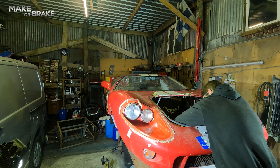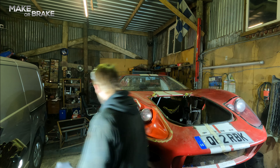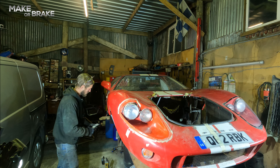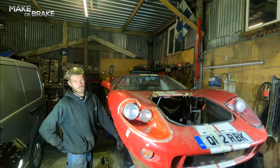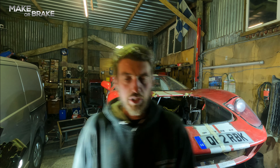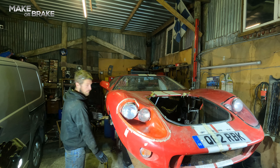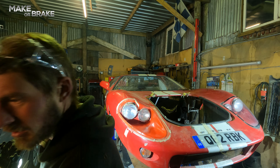So I did mark the centre line — there, the weight. That's our front end where it needs to be. All I need to do now is measure the cross, find the centre line of our wheel arch and run a line straight down to my table. I'll probably find this around about 60mm back from the old centre line of our front spindles — that's my guess, we'll see if I'm right. What I'm going to do is essentially make a plumb line: I'll take a piece of wire, let it drop down with a weight on it, and transfer that line across to the table. Nice and simple.